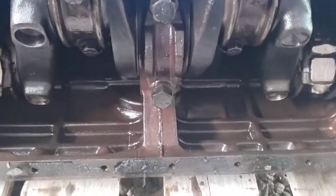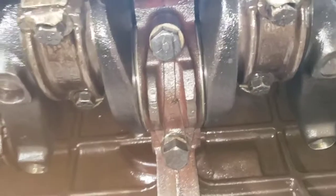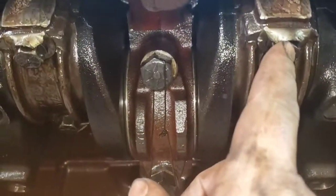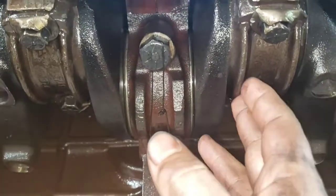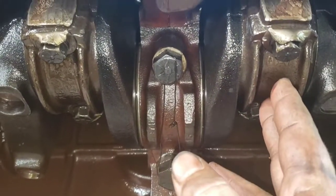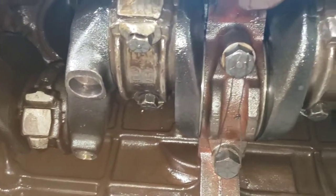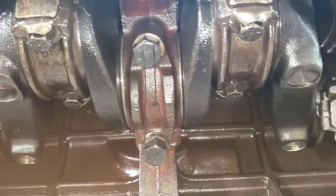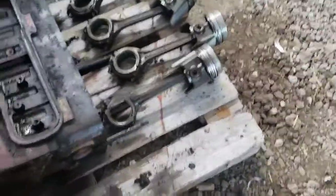Now we're going to go after pistons. There we just got more fold over locks. 2 bolts to take the cap off. They should just push right out the top. Get to doing those on all 4, and we'll come back. Alright, got the pistons out.